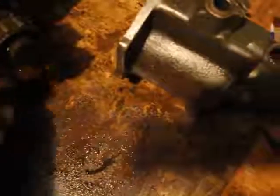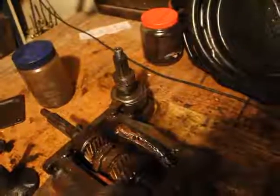See, there's a slot there. So if this thing doesn't come out, you won't be able to remove the housing because it's going to be attached to this here. It's going to be pulling on this. So pulling the lever up disengages it from this shift rail here. That's what it's called, shift rail. And then you can just remove the whole thing, and that big gear there stays.